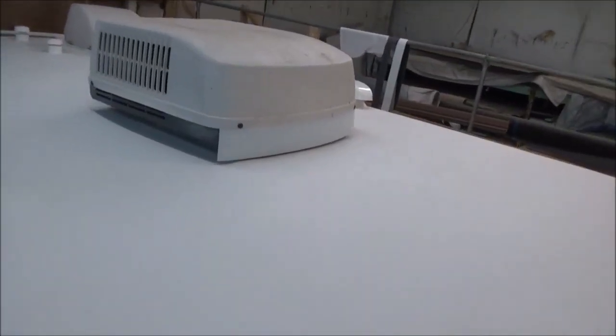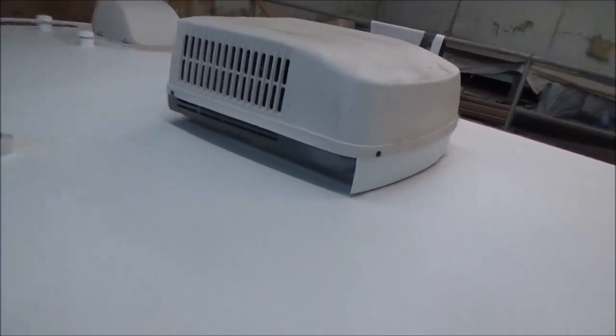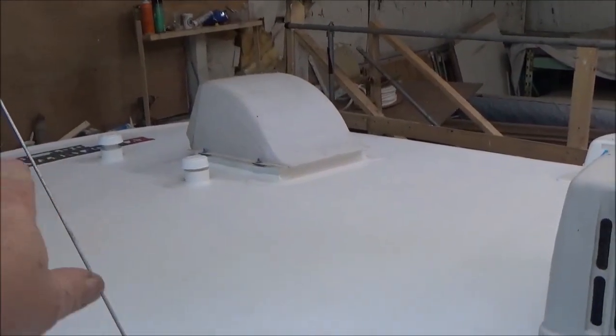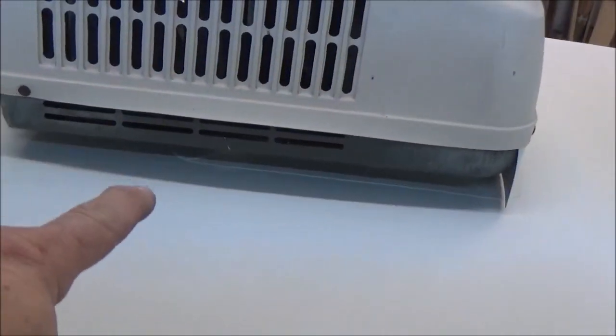We've got our flashing detail on the front of our air conditioner, and then we've got all of our curbs welded in. We've got the boots here for the radio antenna, and the curbs over there. Got a couple more boots for the plumbing. We've got a refrigerator. So the whole point of the front piece flashing is that if you get any rain that's just barreling across here on a heavy storm, when the water is coming down, it'll go down to the pot on this flashing detail, and then it'll roll out from underneath. So what's up underneath there is the same as this one over here.